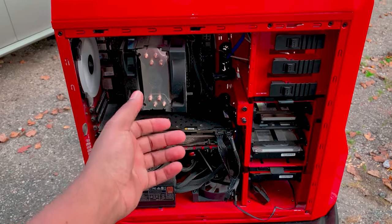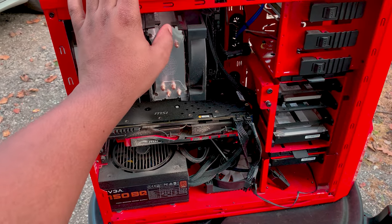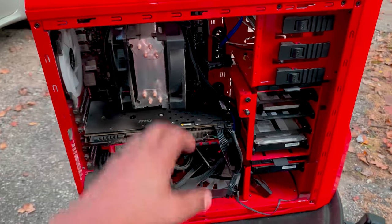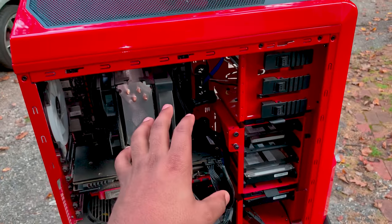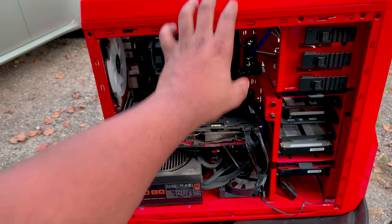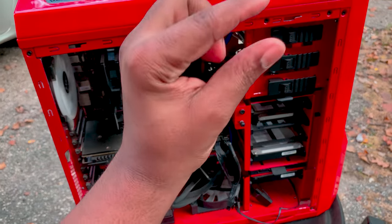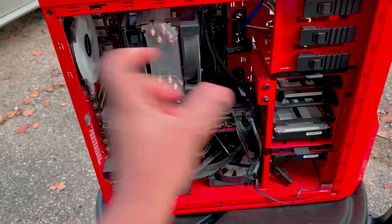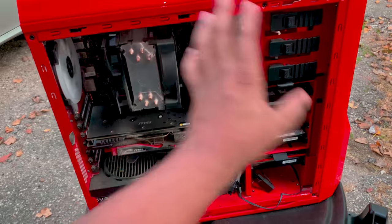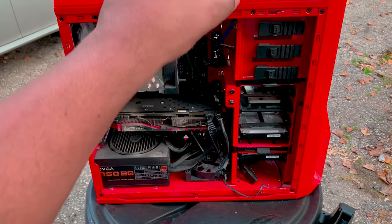However, in my line of work, I'm an IT professional, did a lot of deployments, also a lot of maintenance for governments as well as businesses, computer builds, a lot of computer refreshes or even deployments, of which some may have required that we do a full system clean. The spray can, let me just tell you. When you run into a system, especially like a cashier machine that just sat on the desk for years and years, it's thick dust buildup. Those little spray cans, that's not going to get it. So you have to use something like a vacuum cleaner and blower to completely clean the computer system. I've done this a lot of times for a lot of years. So I know what I'm doing.